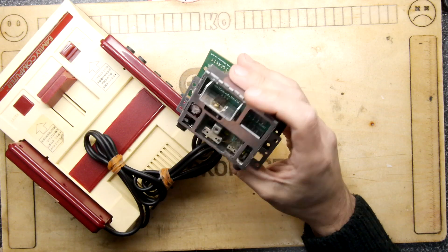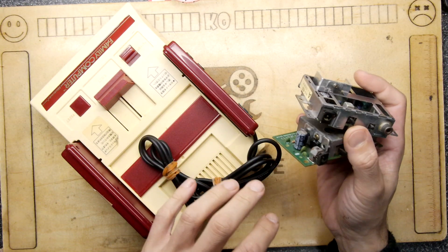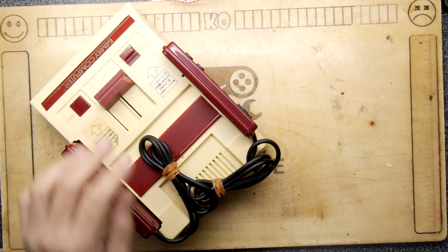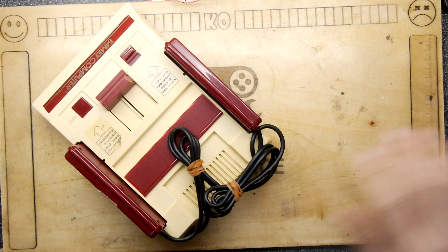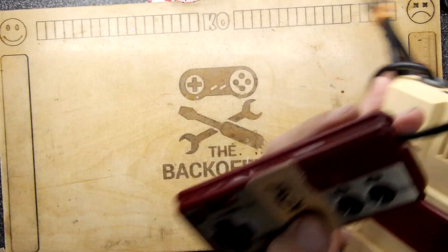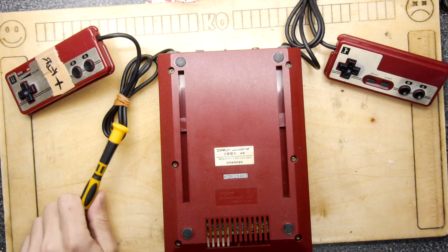The second problem with that, they actually contain the power supply for the Famicom, which of course will be starting to fail now — there's caps and all sorts of stuff going wrong on them. There's actually a third issue as well: the polarity is center negative. So by now, you've probably tried it and decided your Famicom doesn't work because you're not getting any picture out purely because your power supply is wrong. So Lorne said he hasn't tried it out, and I'm not going to try it out as in right now, because frankly, I don't like the power supply.